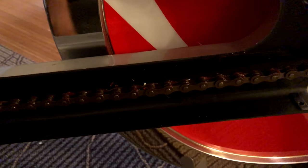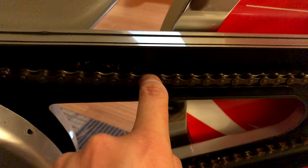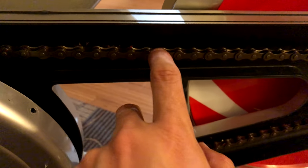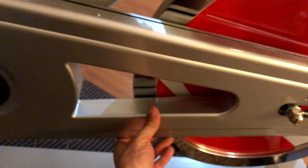Here's a quick inside shot of everything. You have your chain ring, a basic chain with some grease already applied — looks like automotive red grease — and then your single-speed cassette. This is how to adjust the tension on the chain: from the factory it has about half an inch of movement. If you're having issues with your chain and want to know how tight it should be, aim for about half an inch of movement. This whole cover just swings around and is held together by ten screws all around.